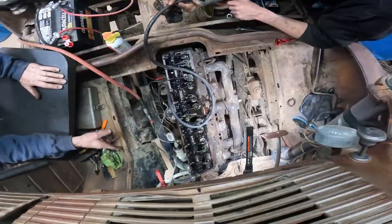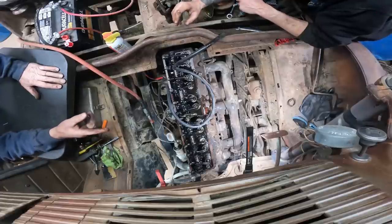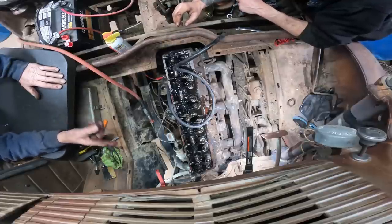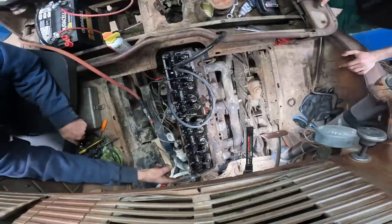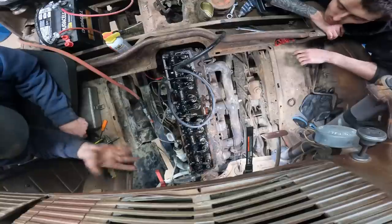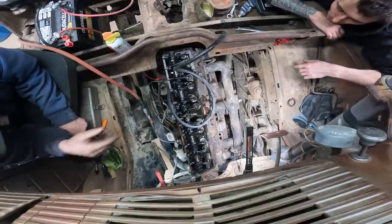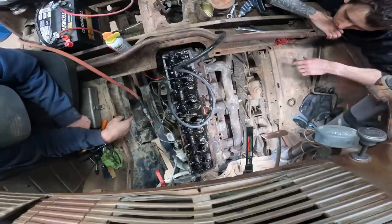Now you have to run a hose from here to your carburetor. Tomorrow, we're cleaning up right now. Put a filter in it right before the carburetor, or I don't care where you put it in the line. That hose, you could actually put up and over and down if it's easier. Okay. Or underneath, whatever's easier. This isn't clamped. You need to clamp this one. I'll take care of all that in the morning.